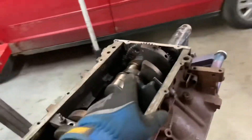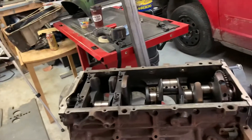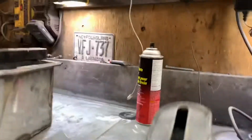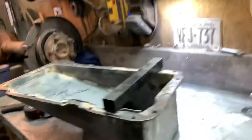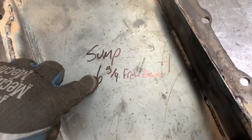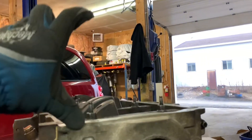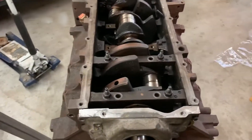While I'm waiting for this to cool down, I'm going to check out the sump and do some measurements. I already set up the pickup tube right here and it is a quarter inch from the base of the oil pan. After my measurements I found out I need my sump to be six and three quarters inches from this surface of the block to fit correctly, which shouldn't be too difficult. Let's get to it.